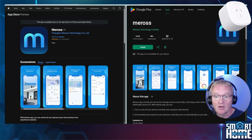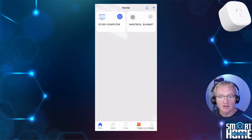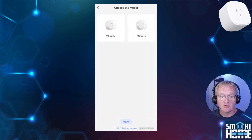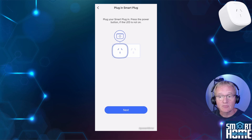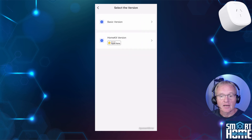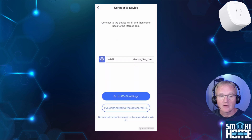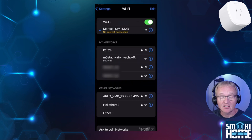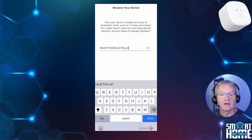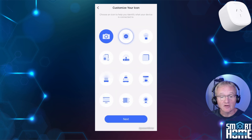We're going to need the Meross application. I'll put links for both iOS and Android in the description. For the purposes of this tutorial, I'll be installing it on an iPhone. I'll assume that you have already downloaded this app and set up the account. Plug in your Meross plug, press the plus icon in the top right-hand corner of the screen, and select smart plug. Now select the MSS310. If the LED on the top of the plug is not flashing, press the button to turn the plug on. Now press next, confirm that your plug is flashing green and amber, and press next. Now select the pairing mode — we're going to use basic. Press the go to Wi-Fi settings, select the Meross plug hotspot and switch back to the Meross application. The Meross plug will be found and added to your account. Give your new Meross plug a name and press done. Select an icon and press next.